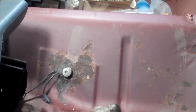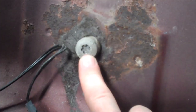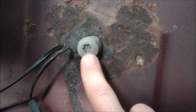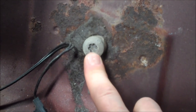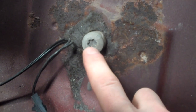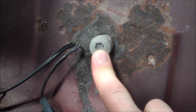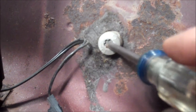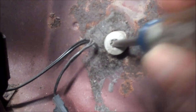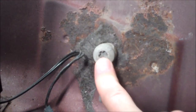Because they are a real pain to remove. Also, you have to make sure that the Torx bolt itself is clean of any residue, because this is a pocket. Over 30-plus years these bolts tend to fill up with all sorts of dirt and grime. So with your Phillips screwdriver, a pick, or anything like that, go ahead and dig out the bolt to make sure it is nice and clean in there, or blow it out with air.